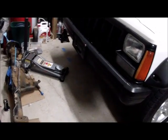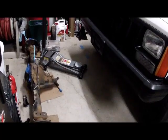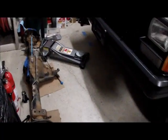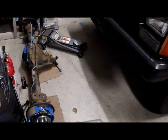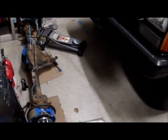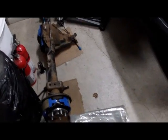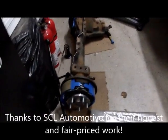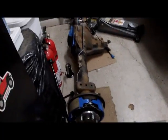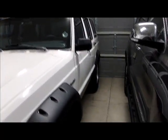I'm about 15% into the build. I found an axle just south of Albuquerque, but when I took it to the shop they found problems inside, so that was $150 wasted. Fortunately, the shop had another one out back in perfect shape. I changed the gears to 4.10s from G2 Axle, put in 10 factory chromoly shafts, and basically rebuilt the entire axle — everything inside is brand new. I even replaced the brake lines since it had been sitting out. I've already installed the Full Traction rear hose from the kit and the ARB airline is already plumbed. The brakes are fully rebuilt — new wheel cylinders, shoes, springs, and hardware on both sides. This axle is ready to go into Project Simon.